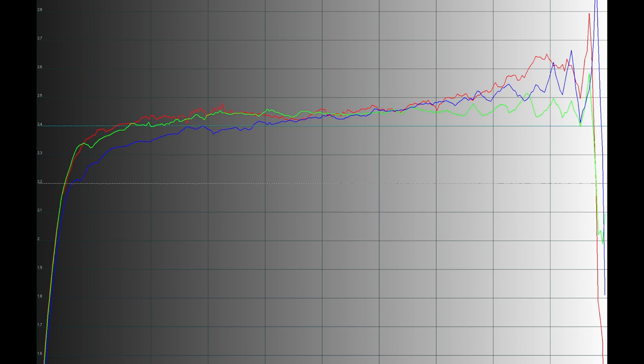My one real gripe would be that they shot for gamma 2.4 instead of 2.2, so the gamma is a little bit too high. And when the gamma is too high, not only does it saturate the image, but it also makes the image darker as well. I notice that mostly underneath games, that sometimes content just doesn't look as lively as it should. It's a little bit dim. So the goal was to give the display some pop, but instead some content tends to look too dark.